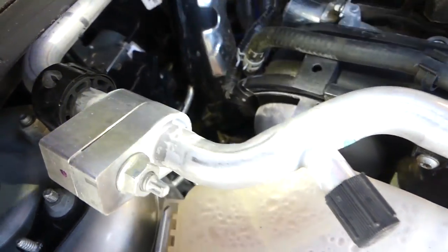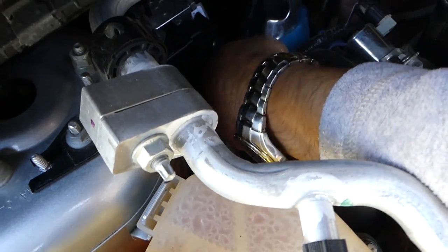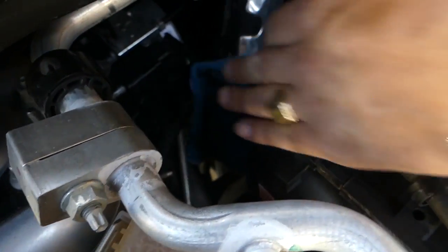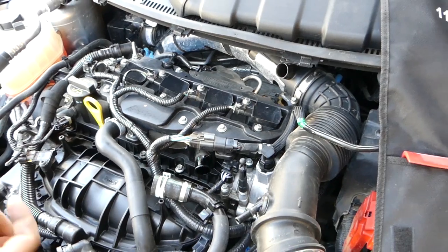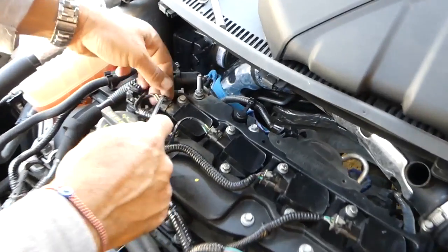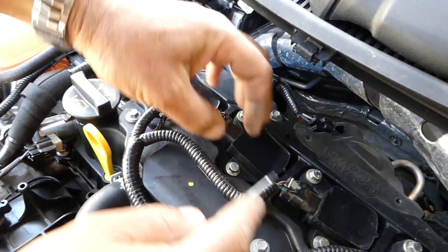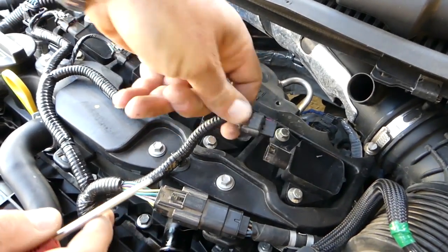It's a limited room on that small engine. We're going to put a towel so nothing goes into the intake hose — that way if we drop a tool it won't go inside, otherwise we'd have to remove it and pull it out. Next we need to disconnect all the ignition coils: pull the gray piece towards the back on all four of them, press down, and pull the cables out.